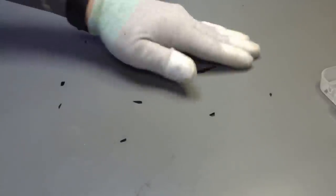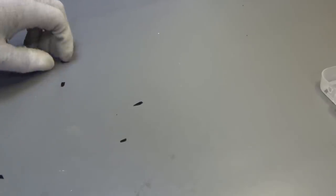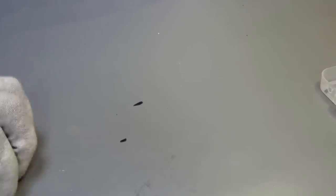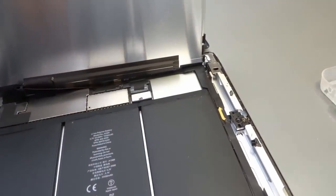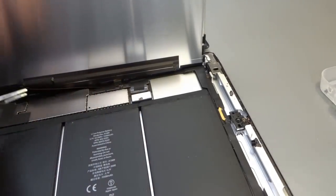Don't force it — it should just gently lift up. The easiest place to get under it is near the home button. Try not to touch the screen as it's quite prone to scratching. Under there are three clasp connectors: one for the LCD and a double connector for the touch screen. Put it to one side, have a bit of a desk clear-up, and make sure you're using gloves — this glass is super sharp and can get stuck in your skin.